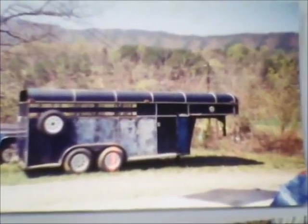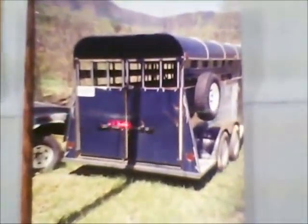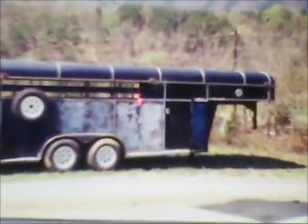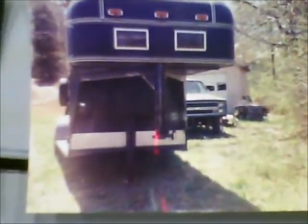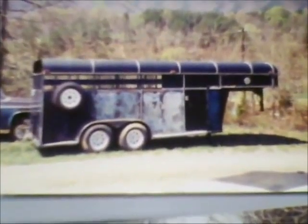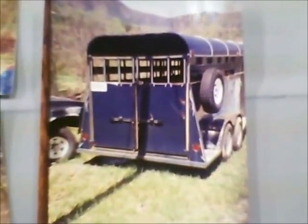We've all been there. This is my train wreck — one of the worst ones. This is the one I sent you the message about last night. I got this thing and the guy wanted me to paint it to match his truck. That was back probably the second thing I painted. On one side they'd already done a little bit of body work. As I went around this thing and tried to do all the sanding and the body work, you can see it's a real dark blue color. I primed everything in gray primer after I got done, and then when I started putting that color on there, it looked like two different colors between the light gray primer and the dark blue color that was already on there because I didn't do a ground coat — I know better now. I used up an entire gallon of paint, mixed two to one, so that made a gallon and a half, and it still didn't turn out. I ended up having to sand it all back and buy another gallon of paint out of my pocket and a reducer and repaint it.